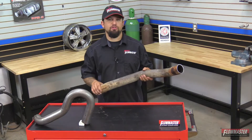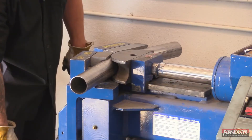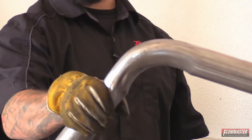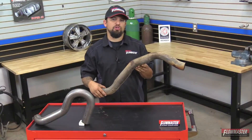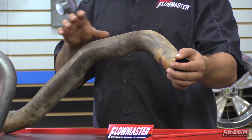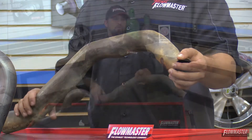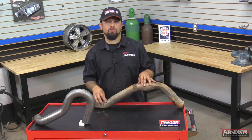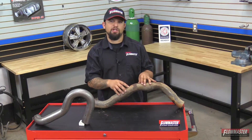The difference between these two is that on a compression bend tubing, it's basically a hydraulic ram that crushes the pipe down to get it bent to that contour. When you do that — for example, on this part — this is a two and a quarter inch tubing, it gets crushed down to two inch, and then you got another nice section of two and a quarter, then it's going to crush down again to two inches. When you do that, you're going to slow down the exhaust gas velocity, robbing you of your horsepower and torque, and also you're going to generate a lot more heat off the exhaust.